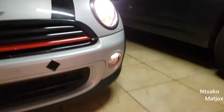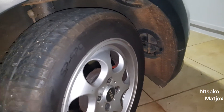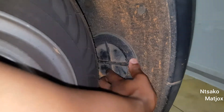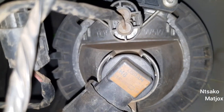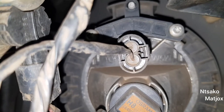It kind of looks funny when we're driving from another perspective. As you can see, the half one is on here but this one is dead at the top. So, according to the Mini Cooper manual, you need to turn the wheel full lock to the opposite way as if it's turning, and then it will grant you access to the inside once you pull that cover off. As you can see, there's two — there's one on the bottom right here and then there's one at the top over there. I'm going to be changing the top one because that's the bulb we're going for.